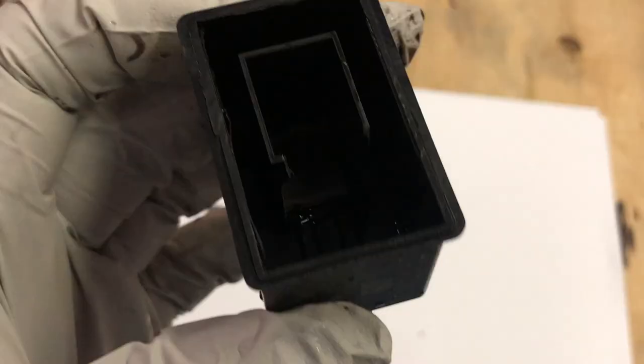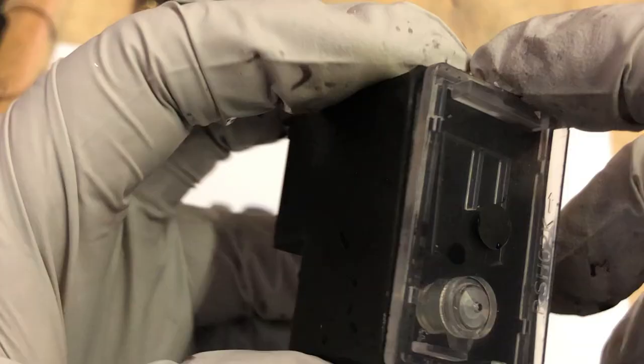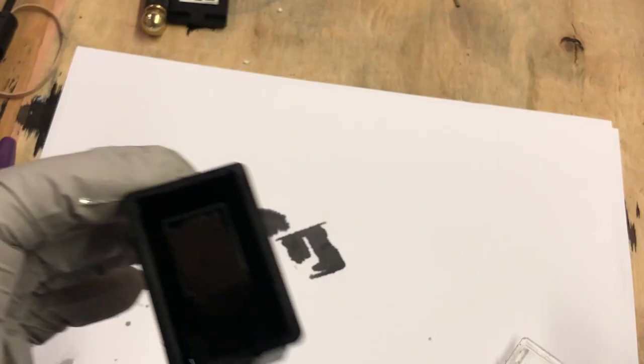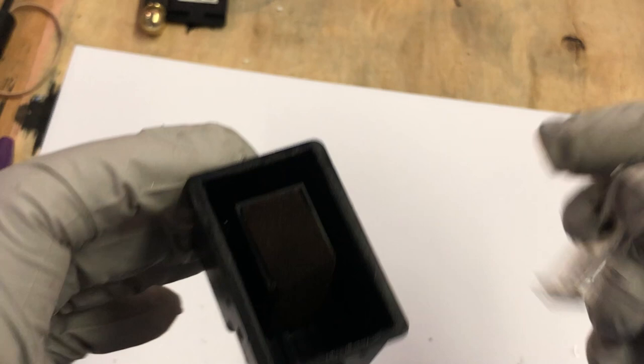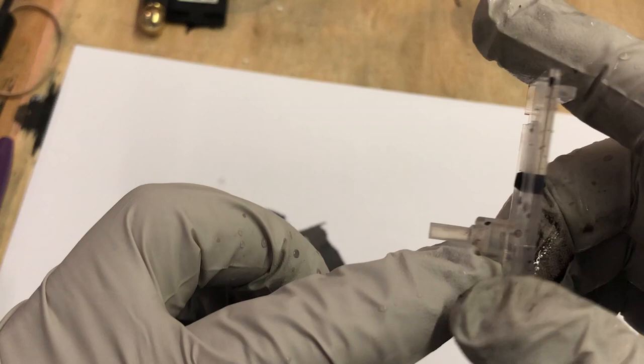We'll smooth out the top and remove the lower portion of the wall completely. You can keep the upper portion of the wall because that prevents you from installing the cover upside down. For the black, if you remove all the walls, it's pretty easy to install it upside down. I put the sponge back in the box. Note: this hybrid only works for non-XL cartridges — XL cartridges don't have this. Personally I don't like the hybrid, but some people just cannot get the completely spongeless cartridge working. Here's something new you can try — with this way you've got two things to regulate the ink pressure, so it may be better.